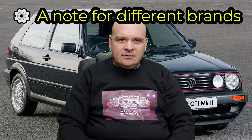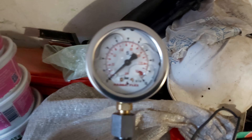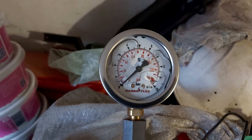If you have a Volkswagen, Audi, or Porsche — lucky you. They use banjo bolts that are included in the kit. For Mercedes, especially V8 engines, you will spend more time connecting the upper chamber side of the fuel distributor. The return line of the warm-up regulator is easy, no issues. The only real complaint is the readability of the scale — it's accurate and stable, doesn't flicker, but it's hard to precisely read values like 1.1, 1.2, 1.3 bar or 4.6, 4.7, 4.8 bar.